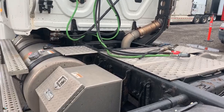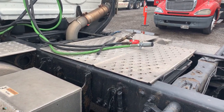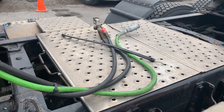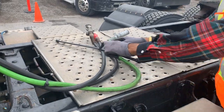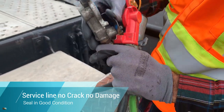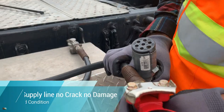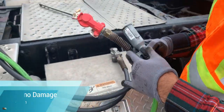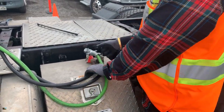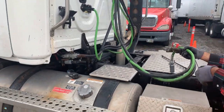The very first thing to do now is the airline test. Grab your electric line and your supply line, check the overall shape — no problem. Check your service line to make sure the airline looks good, no debris inside, everything looks good. Check all the airlines on this side: make sure you touch them and say it's all looking good, no cracks, no damage.